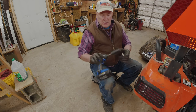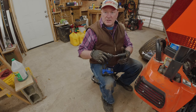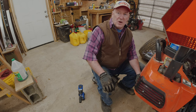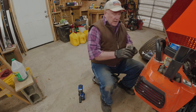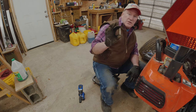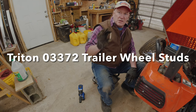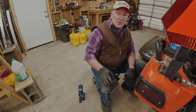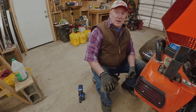With the tire out of the way — the size of the fastener on the rear is 13 sixteenths, and the size of the bolt that goes into the hole is a one-half inch, 20 thread per inch fastener. I have some Triton 03372 screw-in wheel trailer studs. I got these off Amazon. Everything I'm going to use today, except for my tools, I'll drop into a link down below.